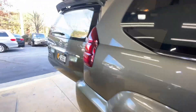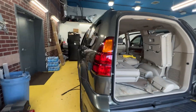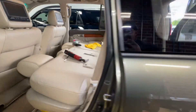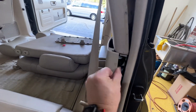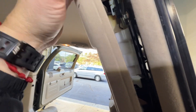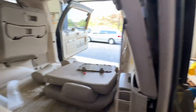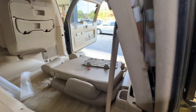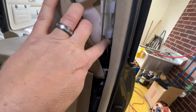The third glass belt molding is more involved. You can see the Prado black belt moldings here. To access it, release tension on the bottom by pulling it out, then pull your window molding off and get behind there with a trim tool. Use shear force with your hands and pop it out. Then there's a 10mm bolt here and a 10mm right there. Use a 10mm with an extension and make sure to use a magnet — if those bolts fall down into the cavity, you've got a lot more to take apart to find them.